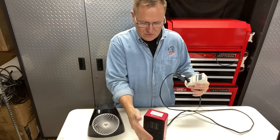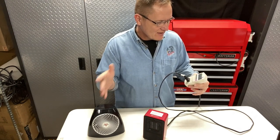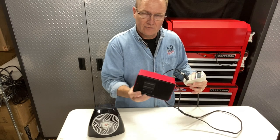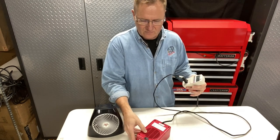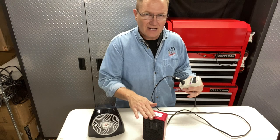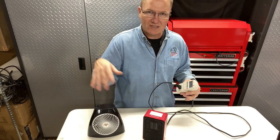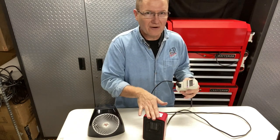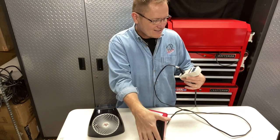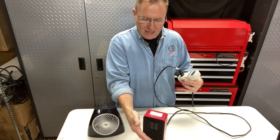It's going to get warm and start blowing warm pretty quickly. Right now it's about 265 watts. It's blowing warm, but — it's still running. I can move it and there's no safety shutoff switch. A lot of these little $19 ones you can find on Black Friday for $10 — there's no safety switch. If you have it on your desk blowing towards you and you're observing it the whole time, it might be okay. But down by your feet where it could get kicked over, maybe not so much. It's settled in at 200 watts and it's blowing nice and warm.